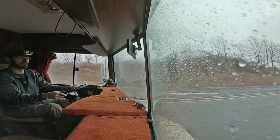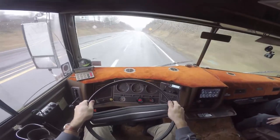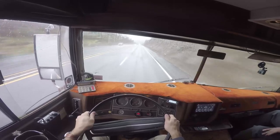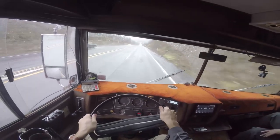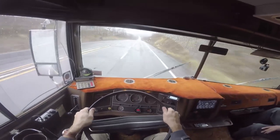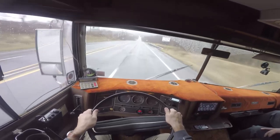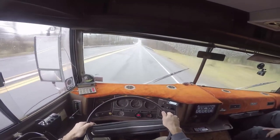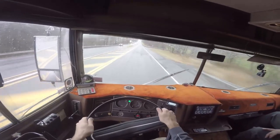It wants to drop down. It's kind of like, roll and go slowly, and it'll kick down at a certain point. If you're going 70 or 65, you can just roll into the boost and use it. But below that, we have the converter lock in a little bit later to save the clutch too. We have a lock at 60. They lock early stock, and I don't know how good this stock converter clutch is, you know what I mean? Once it's locked, it's no problem. It'll hold the power. I just don't know.